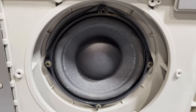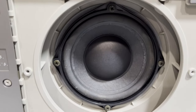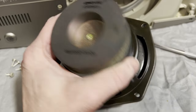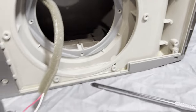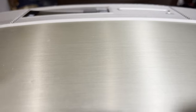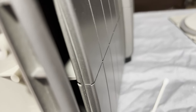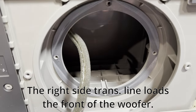Here's some bonus footage for you — there's your subwoofer in a Bose Virtual Imaging Array. I was kind of wrong about the size — it's not six and a half, it's five inch. That's all you get with a Bose VIA. Here's the back side of the woofer. As far as the compression chamber goes — you can see the exit port there, and that's the chamber. Basically that port goes up over top, comes around, and goes up and down and out the side. I believe it leads out this way to the other side, but I'd have to look at the diagram again.